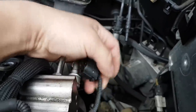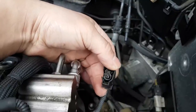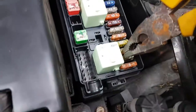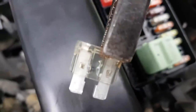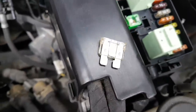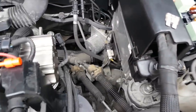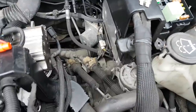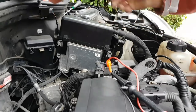When I first tested it I saw 12 volts, but after a few starts those 12 volts were gone and I was confused. Then I found the fuse is blown — right there. We're going to replace this and see if I get 12 volts back. I haven't shorted anything, so unless there's a wiring problem somewhere causing this to blow. Let's put a new fuse in.